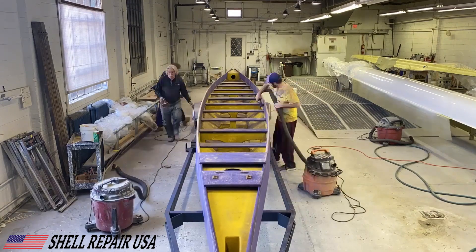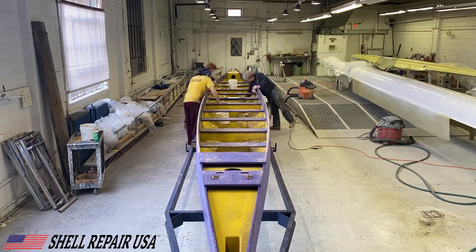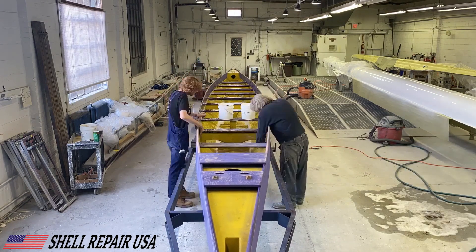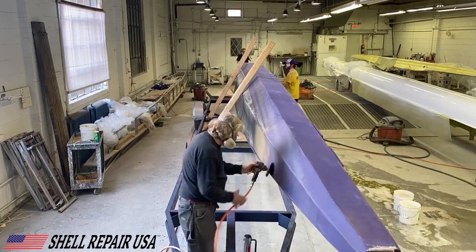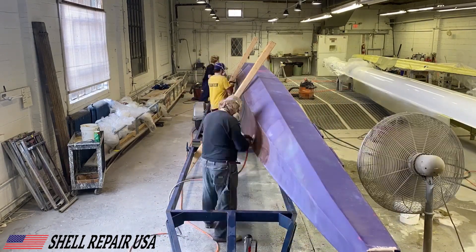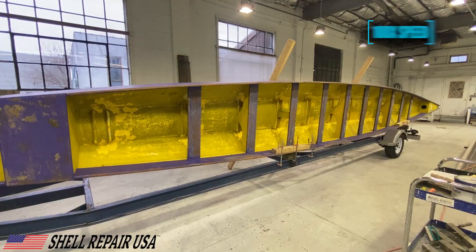Here's the second clip going really fast and you can't really tell what we're doing, but basically we sanded the whole thing down with 180 on DA's, and then we went down the boat with scotch brites and soap, hitting every single surface so it's all scuffed up. Then we turned the boat on its side to start sanding the bottom, and I'm power washing all the dust out of the inside. Here we finish up the bottom and I go ahead and power wash that off.